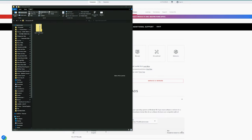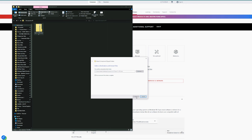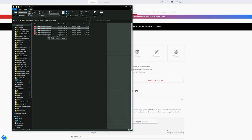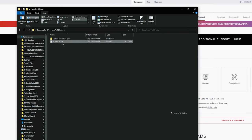Now let's extract the firmware from the zip file — similar process on a Mac and a PC. Right-click on the file, hit Extract All, then Extract. It's going to extract the zip file and we'll get this folder. Inside we'll find another folder with a PDF on how to update the firmware. But what we really need is the .fir file — that's the firmware itself, and that's what we have to get onto the R7.